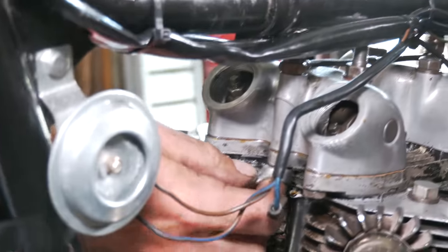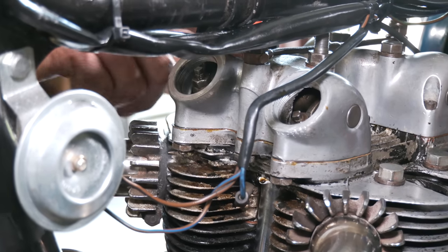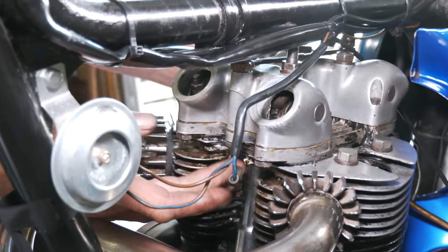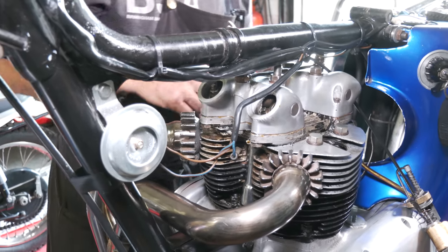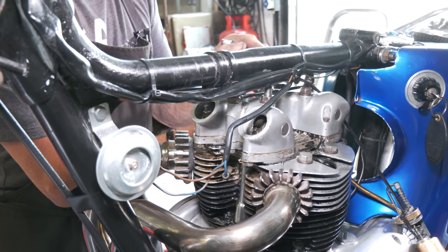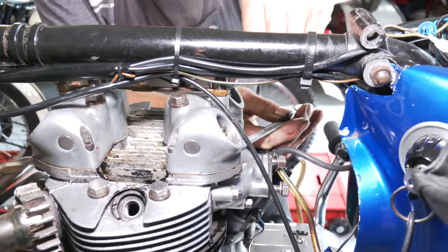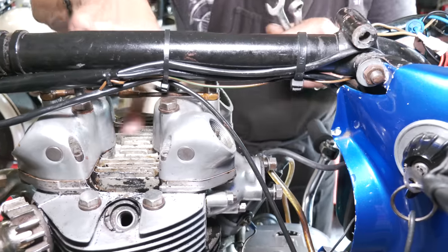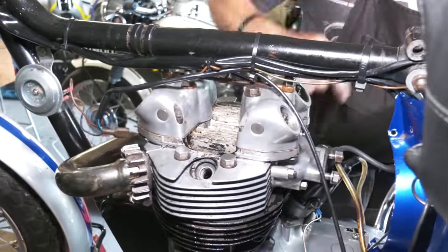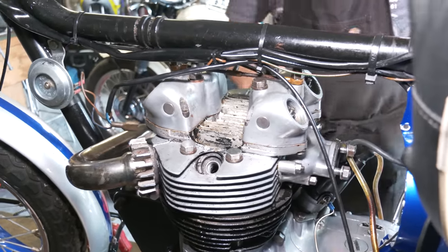When you do the oil union pipe, when you start the engine, do check these copper washers. If it starts leaking, nip it up, but if it carries on, change those washers, because I've had to use the old ones again. We would normally replace them, but I think we should be okay. But just make sure, like I say, always make sure you've done them up tight, because once the tank's on, you won't be aware that you've got a leak and you'll fill this head around the fins here with oil before you realise you've got a leak. So we're ready now to set the tappets.